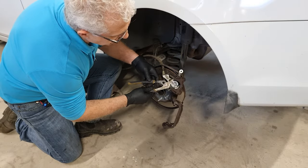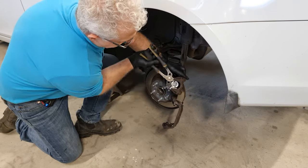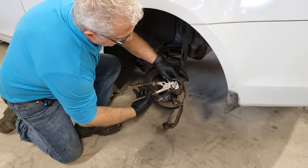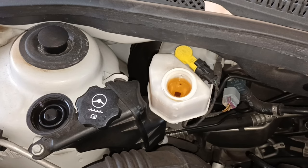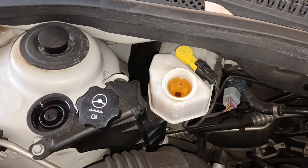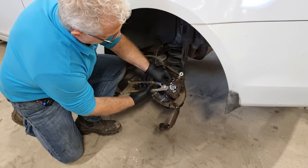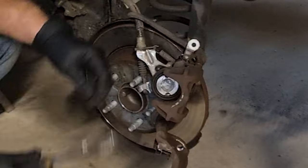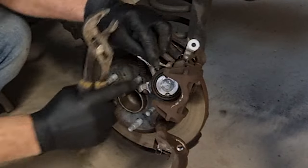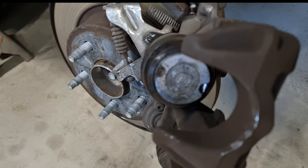All I'm going to do is put the multi-tool around the piston, pull this pretty tight on my hands, and just turn it — basically just wind it in. As I'm winding, you'll see the oil in the master cylinder starting to rise as the piston pushes the oil back. Just be careful if you are using the multi-tool not to rip this rubber around here, because that is a seal. That's all the way in — that's perfect.